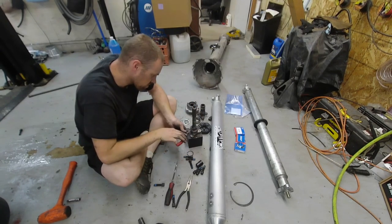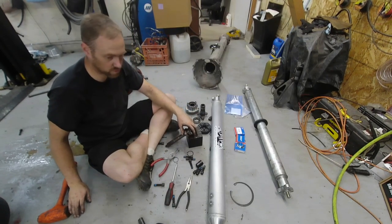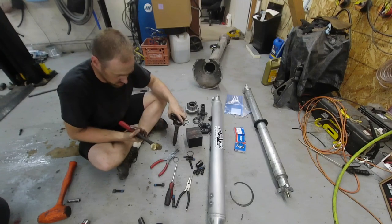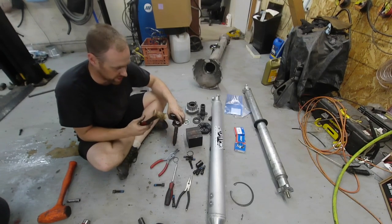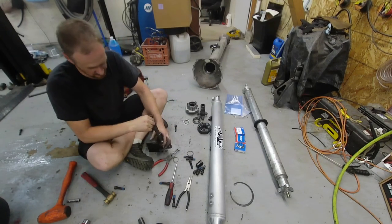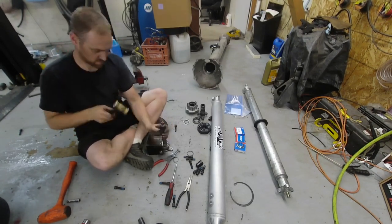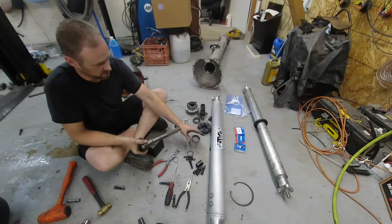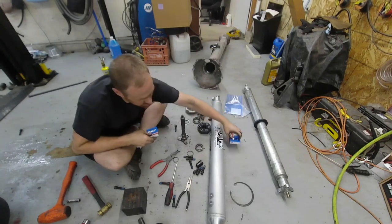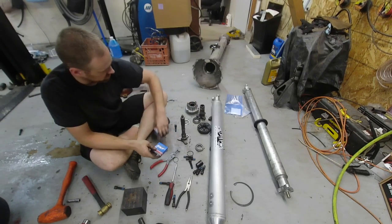This fits. Now we'll do it without the hydraulic press. I should be able to do it with this little brass hammer. I'm only going to use this just to prove a point — this little hammer doesn't take much to get that off of there. There are two different size bearing boxes: these two are for this end because they're the same size, and then this other one is the only different size.